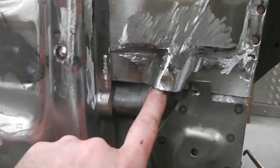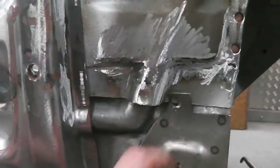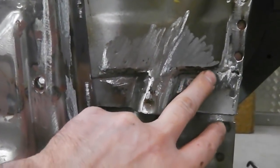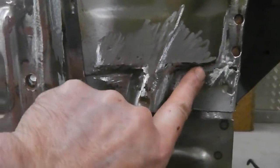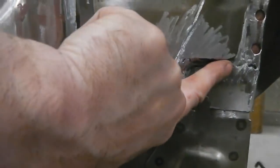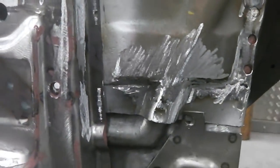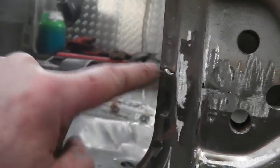That closing up, the gap here, that's normal, like I said. I dented it with the pliers, I'll straighten that up. A little bit of skimming just under there, just to neaten that up. Like a fingerful of aluminium filler in, like that. Close up any pinholes we might have missed. Again, a little finger, a little bit of weld just left to go there and finish that off.